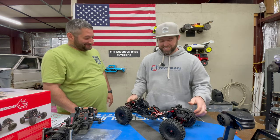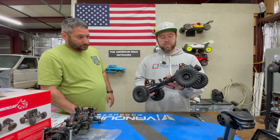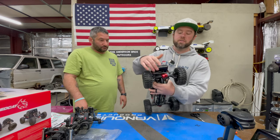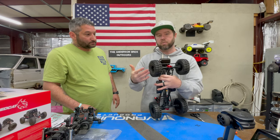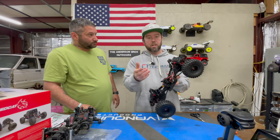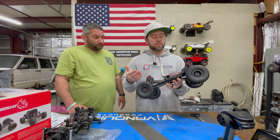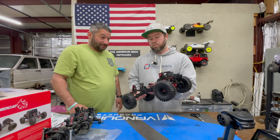Yeah, it happens. It does look like everything else is pretty much the same. It has the same drive lines, so the same axles with different covers. And then the front does have portal weights, which is nice. I don't know how much they weigh. The other major change, obviously, is the Fusion motor. So this is a Hobbywing SE Fusion. It doesn't look like the SE Fusion, but it is. It's an 1800 kV motor. Looks pretty beefy. It is pretty beefy.